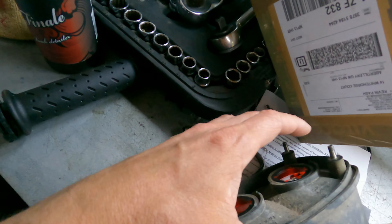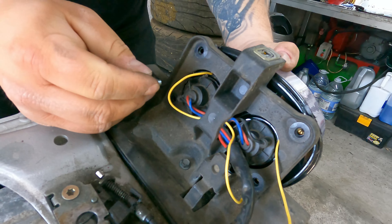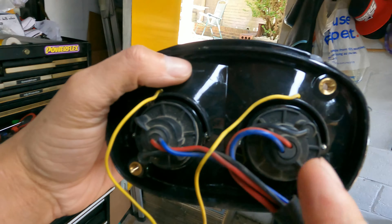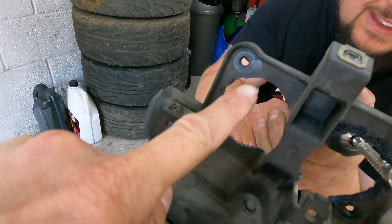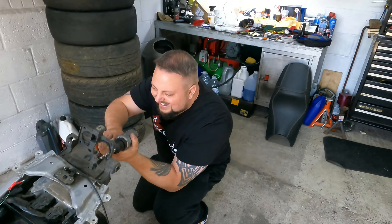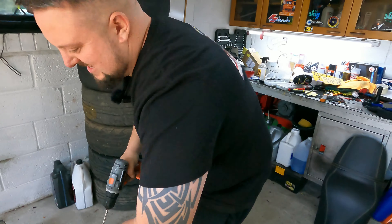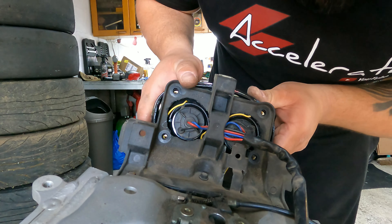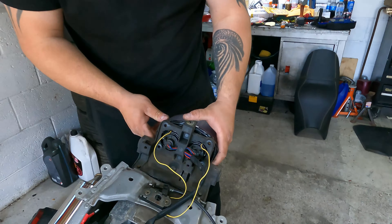The original lights had studs and you put nuts on the end. This one's just got threaded holes — you need to get four bolts, whatever you can find. A problem we've just come across: the circles there help with locating for the mounting of the lights, but it didn't quite sit right. What Kenny's doing now is boring the hole out a bit more to make the mounting points match. We knew there was going to be a bit of custom fabrication, but it's what we do.